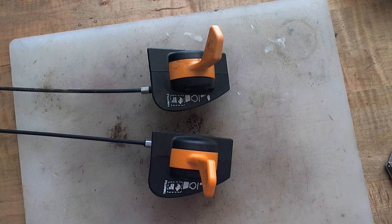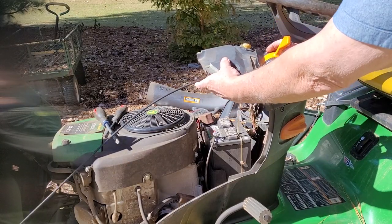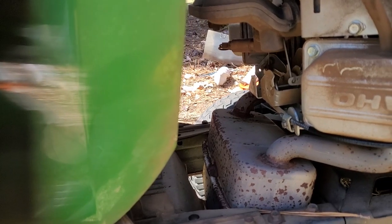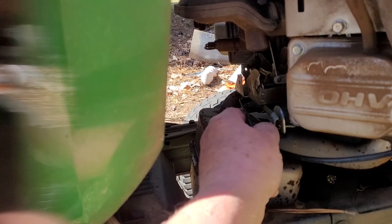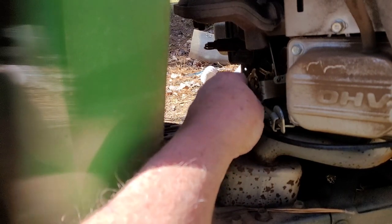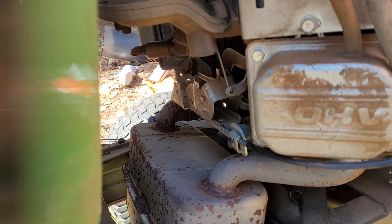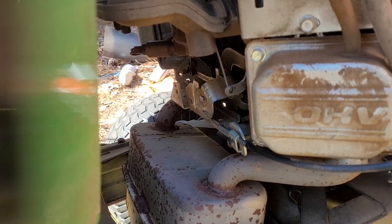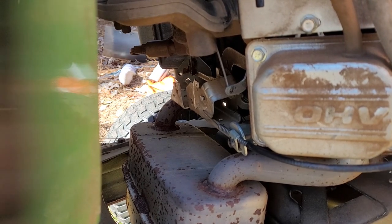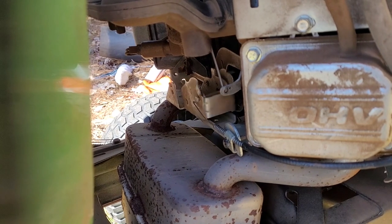So let's go put this in. Install should be fairly straightforward, I hope. Slide that through there, push that down there, and push those little clippies till they clip - they did, good. So what I'm going to do here is before I put it in the clippy, I want to get over here and hook it onto the throttle. I'm going to assume it's that one right there. Sorry I couldn't show you all that, but it goes in this bottom hole down here it looks like. I had to kind of get in there tight - not enough room for you guys to see as well. Pop this guy out, there we go, back in there. So here's full throttle, that's choke, and this then is full throttle here, and that's off. So let's check it out and make sure we got it right.